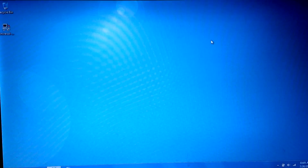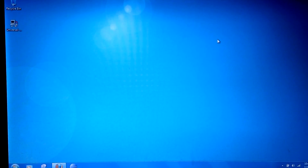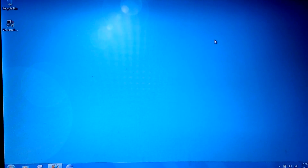You're going to need a USB stick, at least 2GB, and Universal USB Installer — you can download that, it's an open source Linux product — and a Windows recovery ISO or just a Windows recovery disk, and you can skip part of this video.